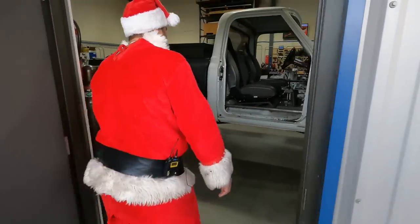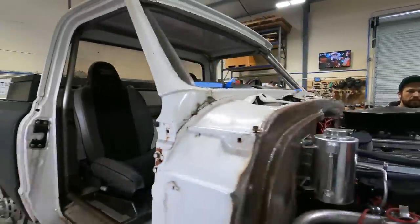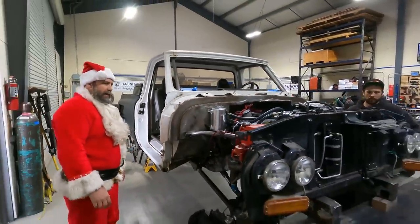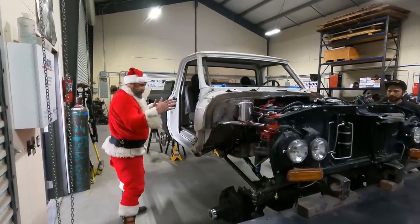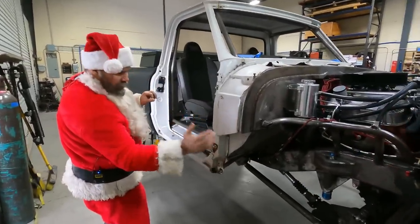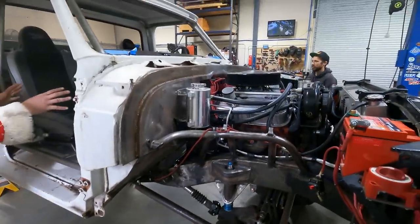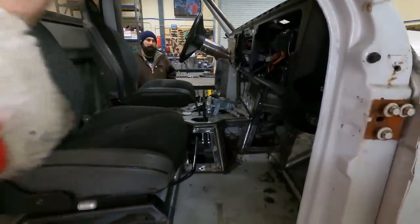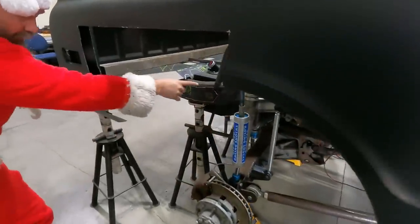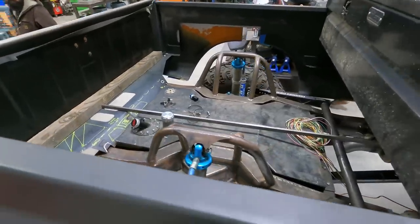All right. So, yep. Here it is, right? Creme de la creme. Caleb's 69 GMC, four headlight. It's got a big block 454, NV4500 5-speed, full WFO truss, 3-link in the front, PSC hydro assist, Chevy Dana 60. You guys have done a lot of work on the inside here. I won't go into too much detail, but look at all the tube work, center console, cage. Full boxed-in chassis, dovetailed in the back for the rear triangulated 4-link. Huge 40-gallon fuel tank tucked in there. We did that at WFO.